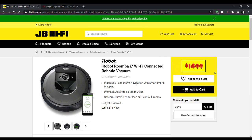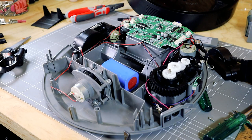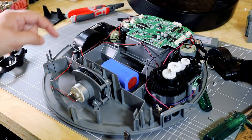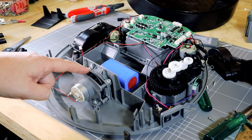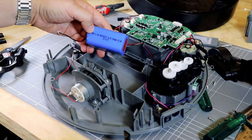For my build platform I searched for the best robot vacuum cleaner that money could buy, and then I found this much much cheaper one. If you're anything like me you may have wondered what's inside one of these robot vacuums. Essentially it's a control board that controls a number of motors — motors at the front that control the sweepers, motors at the side which go through a gearbox and control the wheels, and at the back there's another motor that controls a fan for the suction part of the vacuum. It's all powered by a 4S lithium-ion battery.